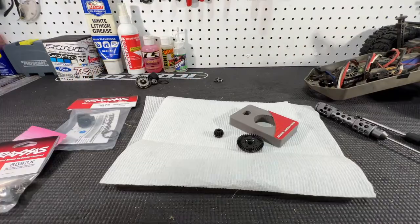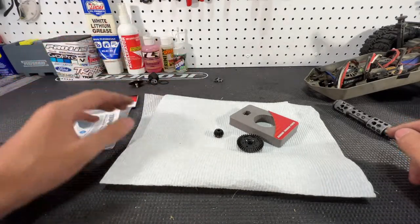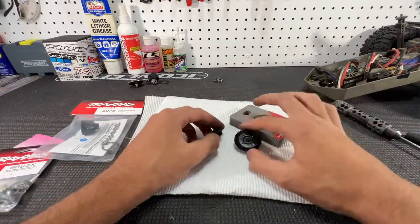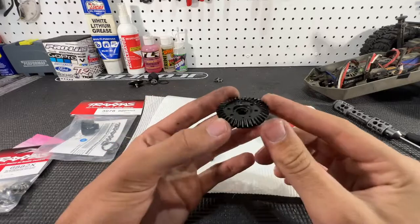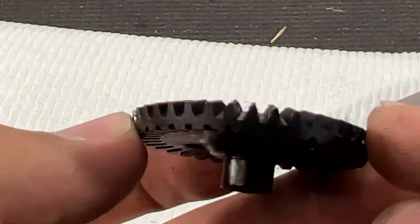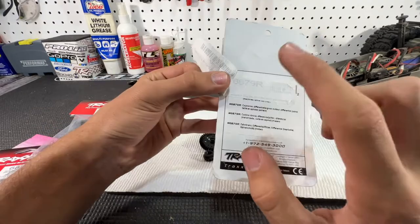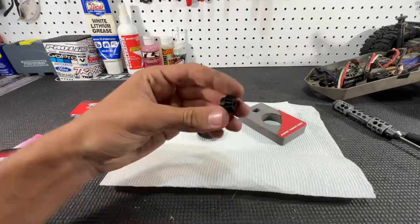So what you just saw was me talking about the old gears and how the X01 gears are going to hold everything together much more — that's still all true. But right as I was about to start talking about the new ring and pinion, I noticed they sent me the wrong ones. These ones are not spiral cut, and if I zoom in you can see there's literally debris on them — they've been used. But the box says it's for machined spiral cut gears, which is the right part number I need. So I'm going to have to return these rear ring and pinion gears.